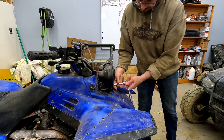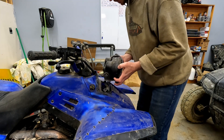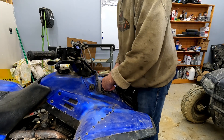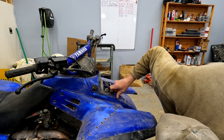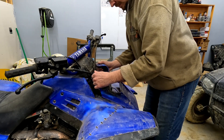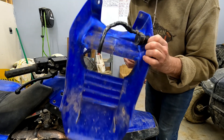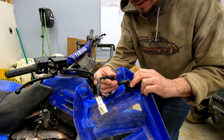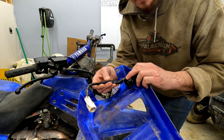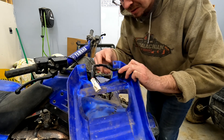It's as easy as popping off the headlights. Let me just leave that unhooked. I do have my suspicions that if it's not the brake safety switch or the clutch switch, it's something in here. When I was messing around with this earlier in the last video, wiggling this would sometimes get one of the relays to click off and on. We'll try the two switches first, and if that doesn't work I might just go ahead and order a new ignition switch and replace it.